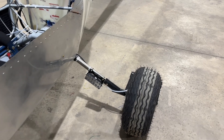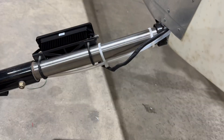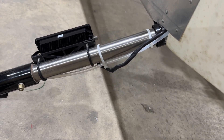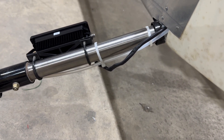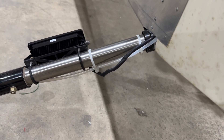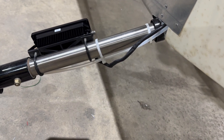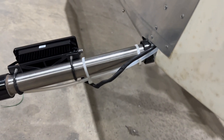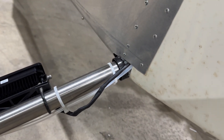The AeroLeds AeroSuns are mounted using the AeroLeds brackets. Working on the wiring, the AeroLeds will tie into the Advanced Flight Systems/Dynon ACM module in the front of the aircraft. It will control the wig-wag of the recognition lights, so I capped off two of the wires from the AeroLeds AeroSuns and then ran the rest of the wires to the front of the cockpit. The wires go from each gear leg up through the opening.